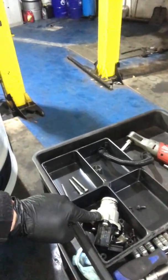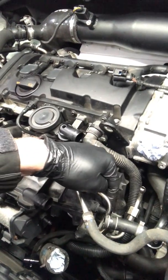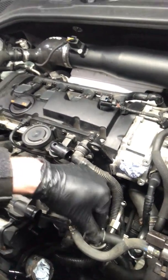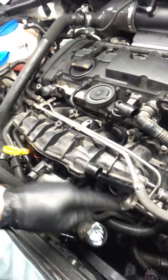There is a knack to fitting one with the manifold still in place. You want the fuel pump off, divert valve off first of all. So PCV pipe, fuel pump — 17 mil here which is the feed to the fuel rail. Get the little rubber pipe off at either end, fuel pump or this pipe, fuel pump out the way, get this loosely out the way of the back pipe, move this roughly out the way.